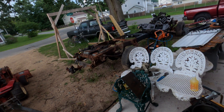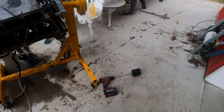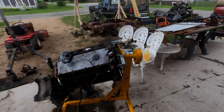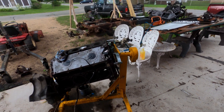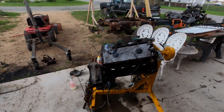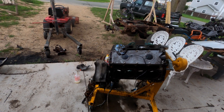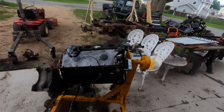You can see at the bottom they're also caked up with carbon. I have a ball hone from when I did my Mercedes - it's not a four inch bore so I'll put it in there cockeyed and ran it around a little bit to knock the crud off. This thing's going back together today as-is, where-is. I'll put you on a time lapse again and show you power washing the pistons, wire wheeling the deck, and putting it back together.